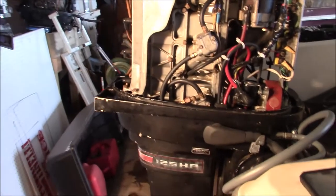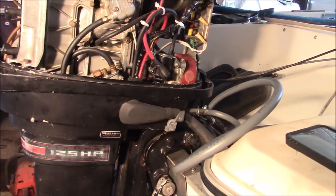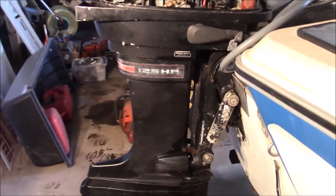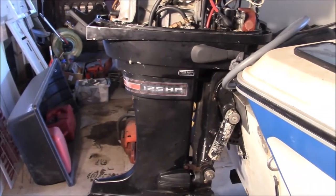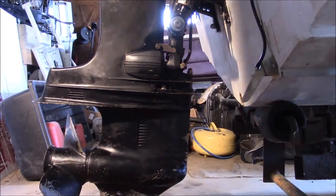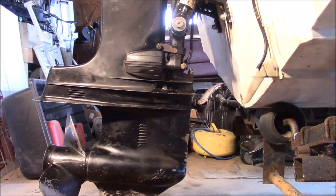Now, for a little backdrop, a couple of design features of these outboards are about trying to keep things from getting hurt if a person happens to run into things with the lower unit. In particular, I'm talking about the ability of that motor to tip forward. Obviously, when you have it in reverse, you don't want the motor to be able to tip at all, because you want it locked just like that. If you let it tip when you put it in reverse, it's going to pull itself right up out of the water. You can have that big L on your forehead saying loser.